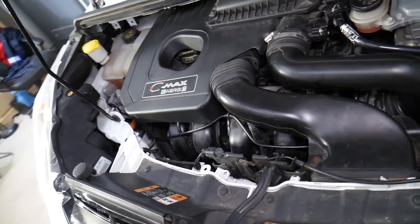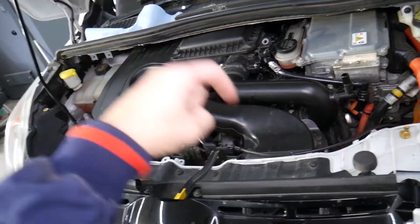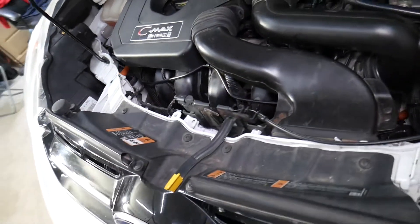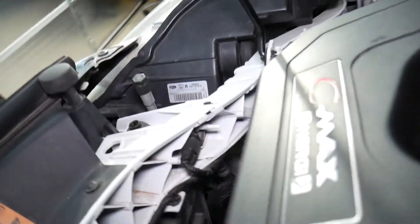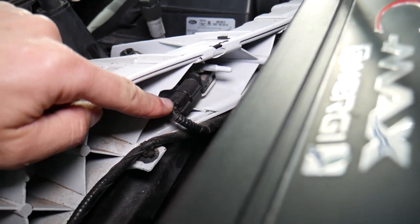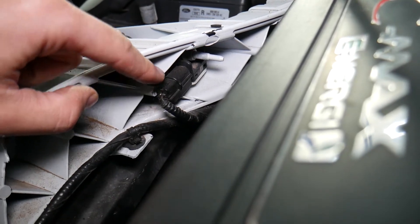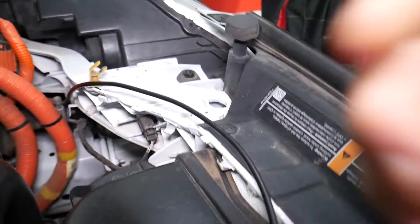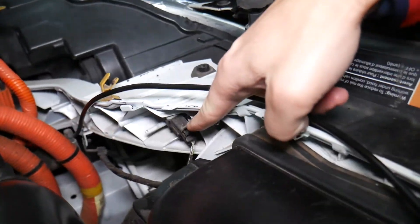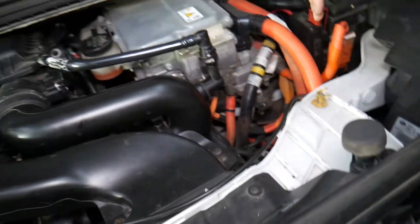We put a link to a video that explains which battery terminal to disconnect first — it's in the description below. Once you do that, right here on the passenger side, that sensor right there is your front right passenger side impact airbag crash sensor. If you come to the left side on the driver's side, you have one more just like that, next to the air intake hose. Practically, they each have only one nut holding them, so you can get them out, disconnect them, and replace them if you need to.